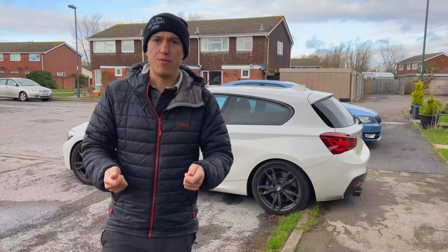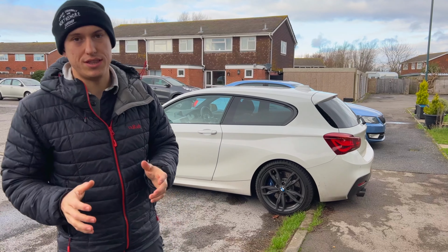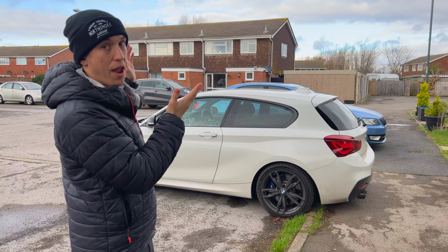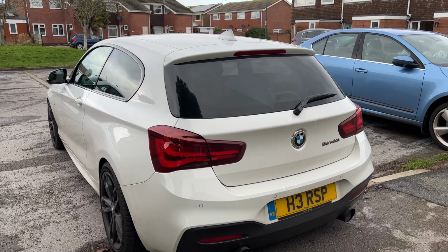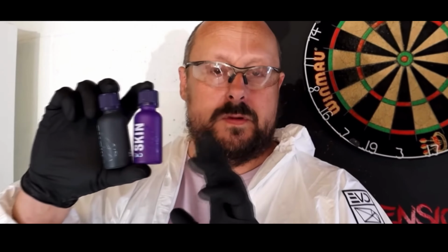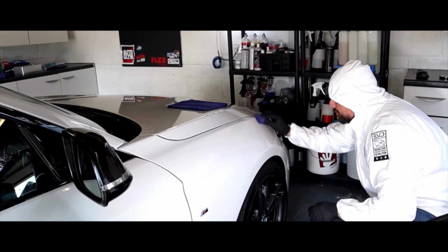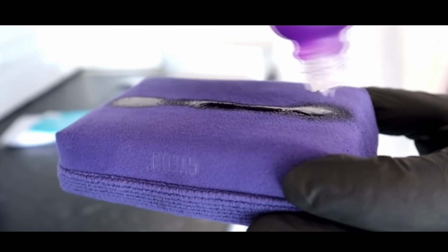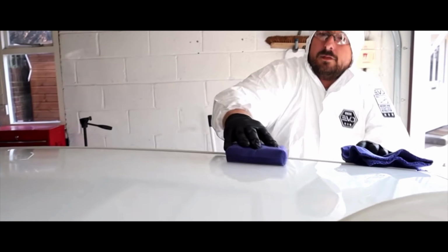So in today's video, we are going to finally do an update video on the ceramic coating that me and John applied to my M140i. The ceramic coating applied to my M140i is the Gyeon Evo Syncro Kit, which consists of a multi-layer application, Q2 Mohs and Q2 Syncro. Mohs being the base coat that will protect the paint from contaminants, provide the durability of the coating and provide a hydrophobic layer. The top coat delivering the gloss, strong color enhancement and enhancing the durability of the hydrophobicity.